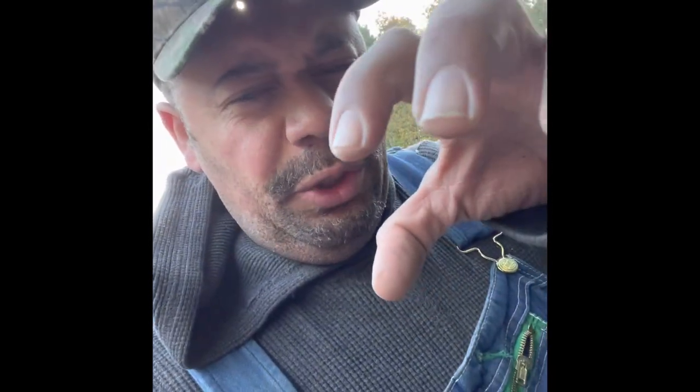All right, guys, so I got the old one out. Take note as best you can exactly where this thing goes back down into. And what it does, it rotates. When you pull that distributor out, it rotates a little bit to the left. And when you put it back down, it needs to go in where it came out at, because it's gonna rotate back to your right.